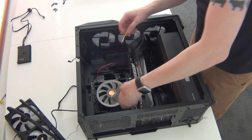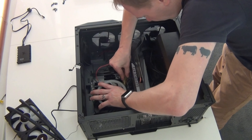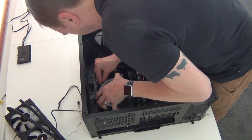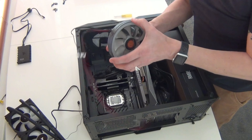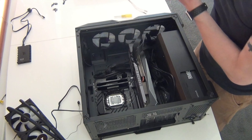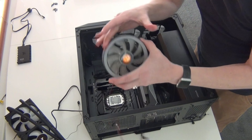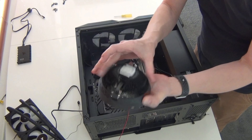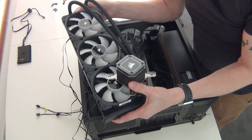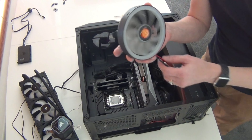There's a little clip on the fan that we push down with a small screwdriver to flip it off. And there we have it — the fan is off. I've already got a little thermal paste on my finger, which is fine; we're going to clean all of that off the CPU. This old fan is probably going in the bin — I have no need for it anymore. You can see it's just one fan with one small heat sink compared to the giant three-fan water-cooling assembly we're installing.